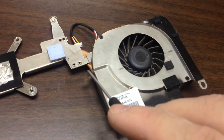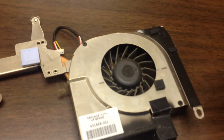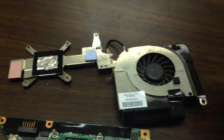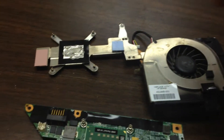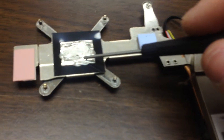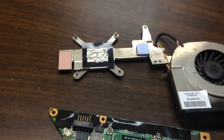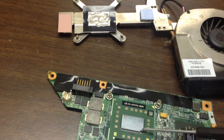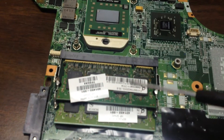We can see that there is some telltale fuzz sticking out the side here. What happens is you have to take these fans apart and clean the inside of the fans — that's one important part. Another important part is this crystallized aluminum and thermal compound on top there for the CPU. That needs to be cleaned and replaced. What we do is put Arctic Silver on there and replace it out.